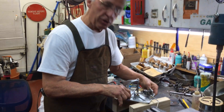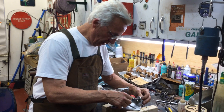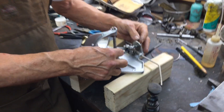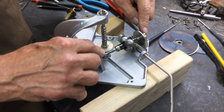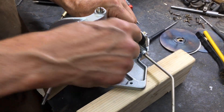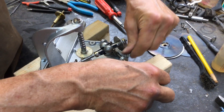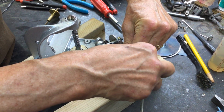So what you do with a snag on this is, you leave everything kind of loose, and you mount the governor with the bearings on. Because this will move up and down, because there's some gaps in here. Then you put the spring in, and you slide this in.